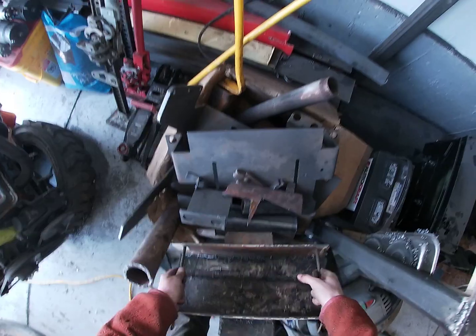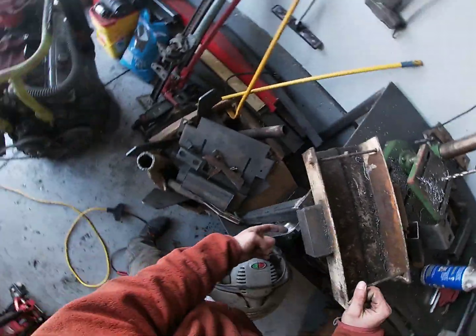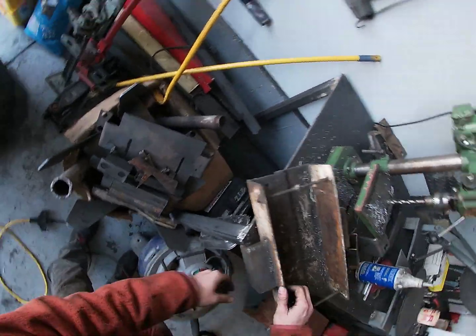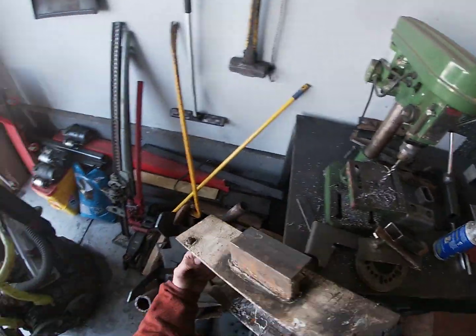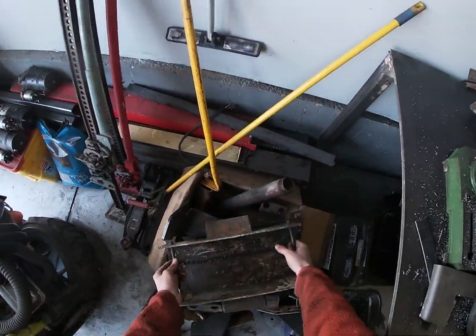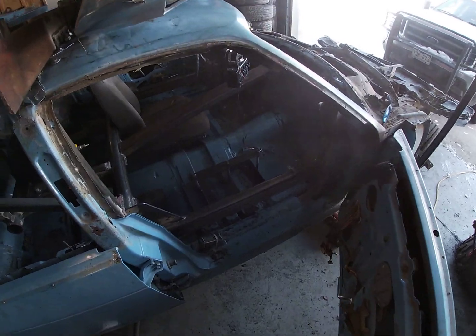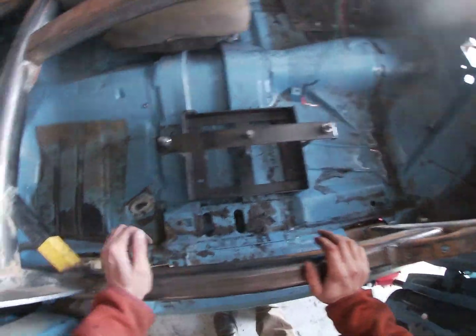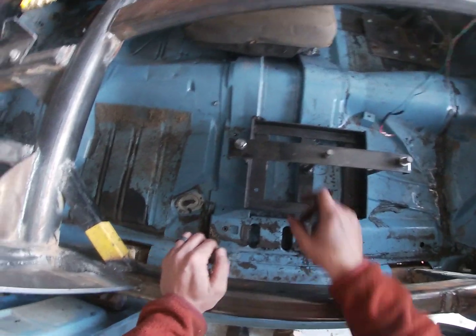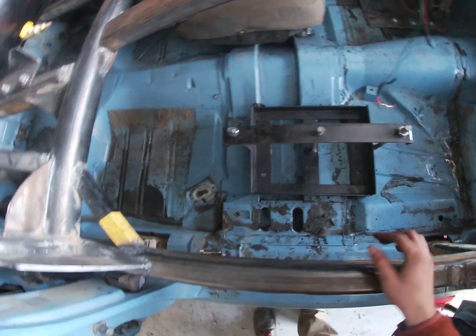With some rod welded on the outside. Battery would slide in there, and then I would run a ratchet strap between these two outer pieces of angle iron, 4 bolt holes. Anyway, I still have it. It's janky, it's crud built. I built this new one that's much nicer. It's gonna bolt in 4 places, same as before. It's gonna hold 2 batteries, and it's gonna have this nice top plate piece that can bolt down.